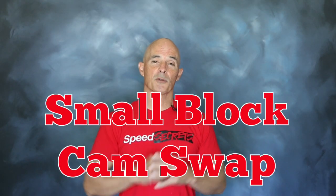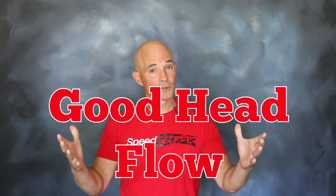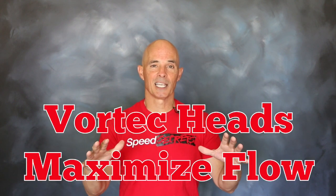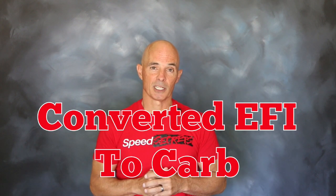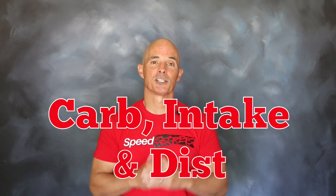To find out how well a small block responds to a cam swap, we went to the local wrecking yard and snatched up a small block 350. We purposely chose the late model Vortec headed version because those heads flow so well. That's one of the reasons an LS application responds so well to cam timing — it has very good cylinder heads right from the factory. So we chose the Vortec headed version to maximize the head flow on our small block. Now that late model small block originally came fuel injected, but we purposely changed that out for carburetion. We installed a 4 barrel intake, 4 barrel carburetor, and a distributor.